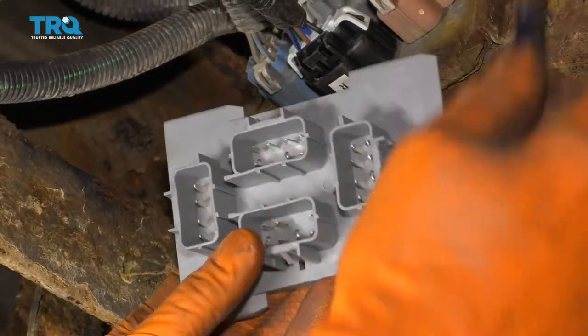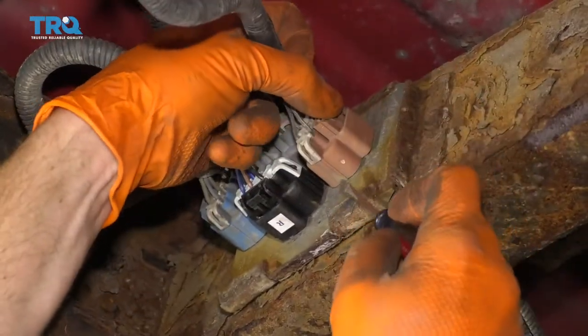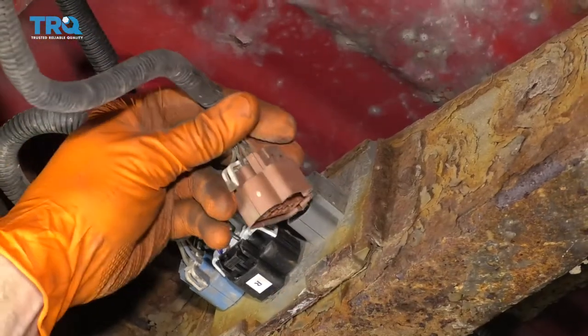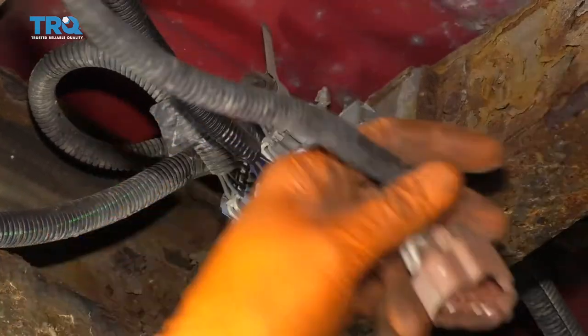The new unit is marked blue, purple, gray, orange, black. With that said, if you grab on this tab right here, squeeze it, and then pry away, this should slide right off. It's always a great idea to look inside of your wiring harness pigtails to make sure you don't see any funny colors. If it's good, set it aside.